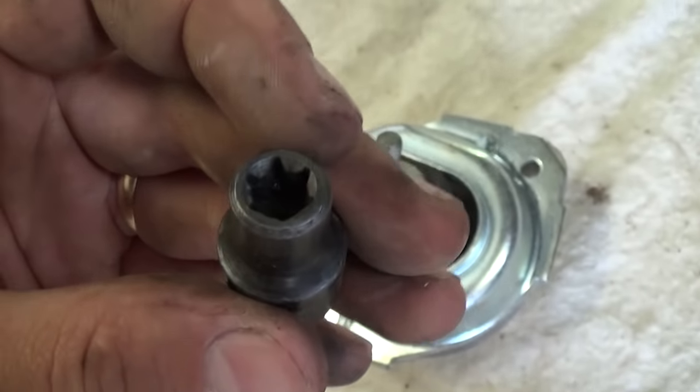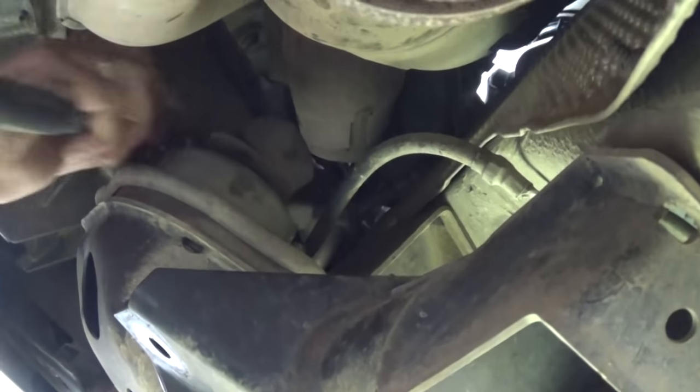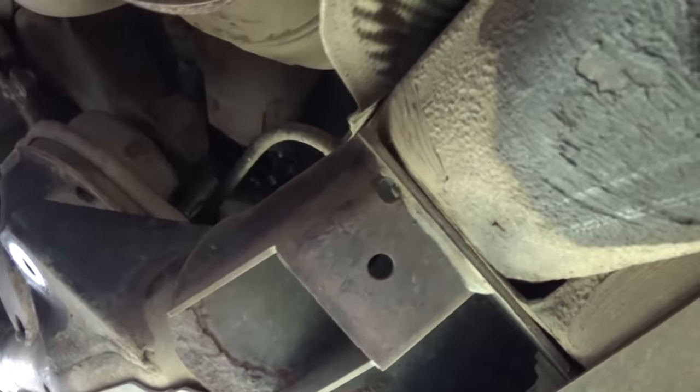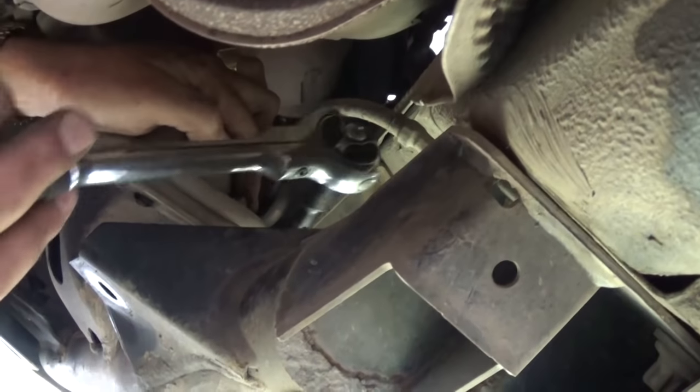So you're going to do this underneath the vehicle. One bolt is on the inside and one is under this wire. You need to take both of them completely off. Use just the socket on the end because if you use the ratchet it's going to get stuck — there's limited room, and the more you unscrew the bolt the more it goes up and blocks your ratchet. Now do the one on the right side on the outside of the engine mount.